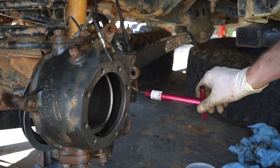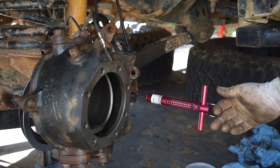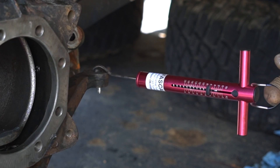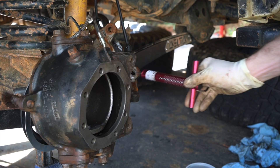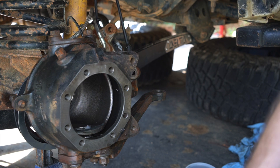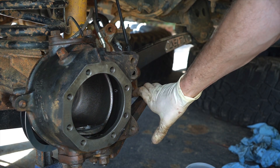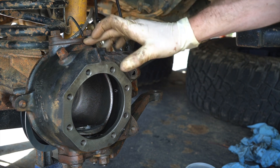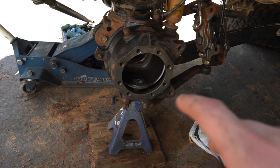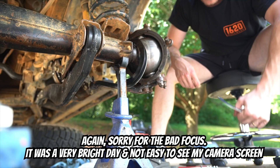Hook the gauge right here on the steering arm — the spec is between 5.6 and 9.9 pounds. If it isn't in spec, we'll have to take our shim out and put in either a smaller or larger one depending on our reading. Go ahead and give it a pull — about 8 pounds as it starts to move, pulling slow and steady. Check it again — about 7 to 8 pounds. That's good, same as the other side specked out. Before you measure, go ahead and work the knuckle back and forth a bunch to make sure everything is seated before checking spec. If your spec is way too low you need a thicker shim, if it's way too high you need a thinner shim. Now we can start getting our plates on the back of our knuckle. Check your spec before putting the seal on — it'll throw off your reading.